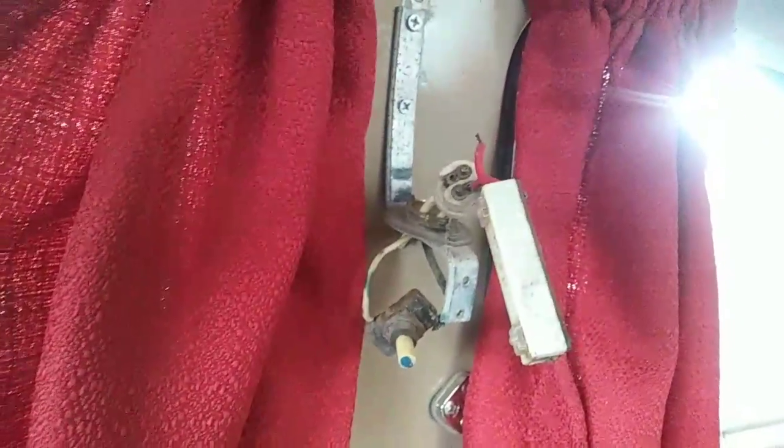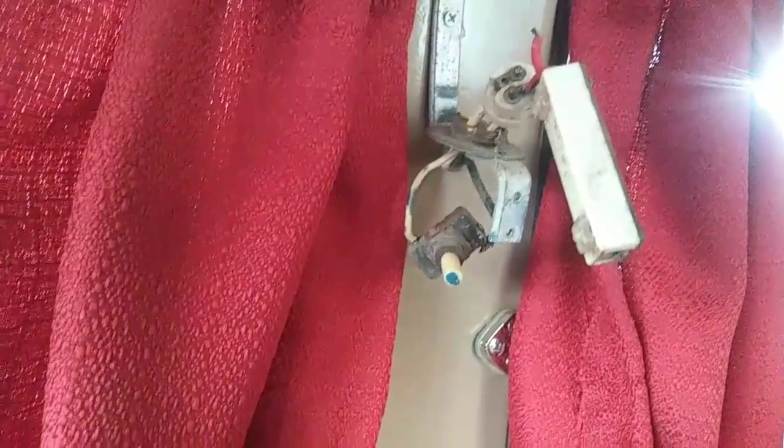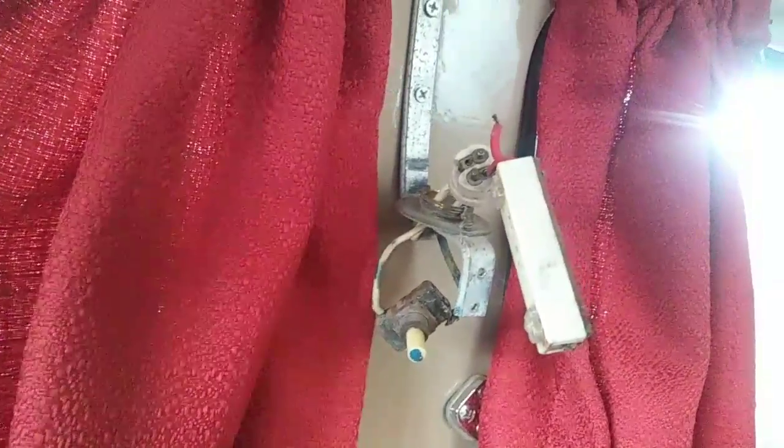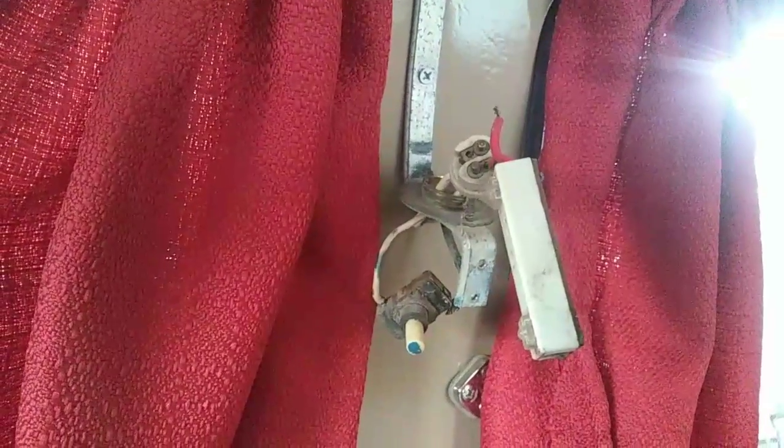On the way back from the last show, I just went to the generator. Of course, you know, the old generators are crap on these things. What happens is the wires inside of them just get old and fall apart and ground out, and then it causes everything to go south. So I'm going to put an alternator in this thing probably tomorrow, and maybe I'll get it out to Octo. I'm not sure. I'm hoping I can get that fixed.